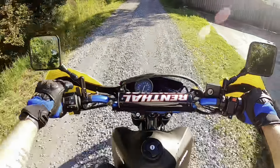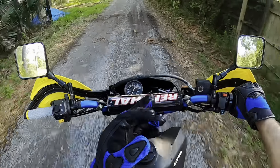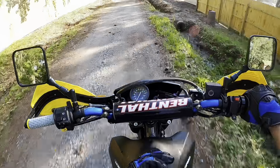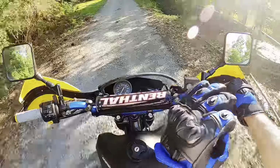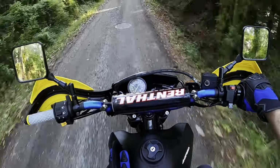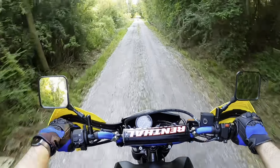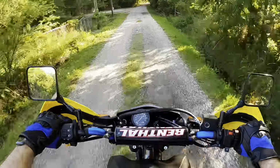So I had to take the tank off, and I had to cut a lot of straps and move a lot of things. The fuel lines were the most difficult part. They are maxed out, but I can get full turn on both sides. It was my right side turn that was really stretching the line out. I had to move the gas tank. What's that little rubber mount piece for the gas tank? I had to move it around that to get it to where it could click all the way over to the right. So yeah, that was probably the toughest part. But man, it feels like a monster now, dude. It feels like a big bike.